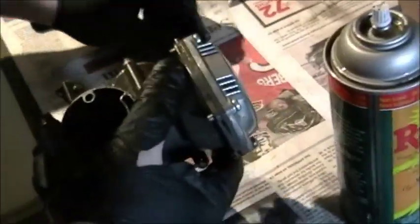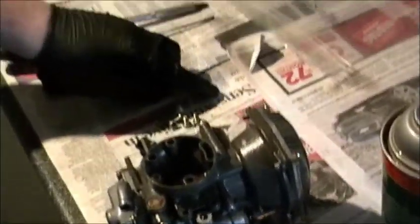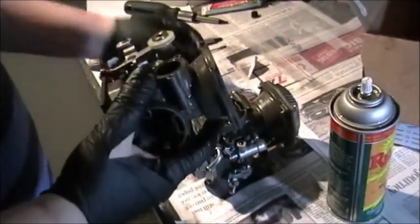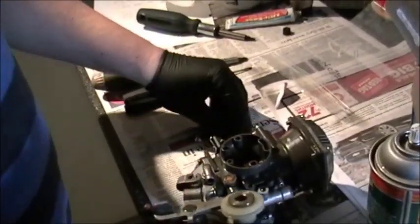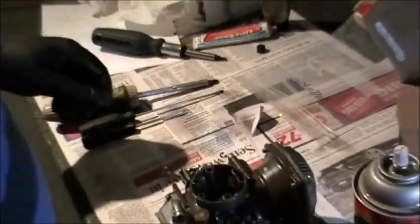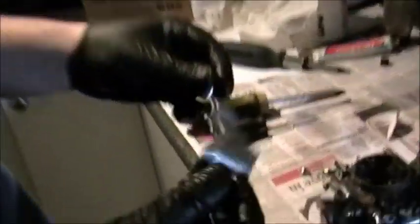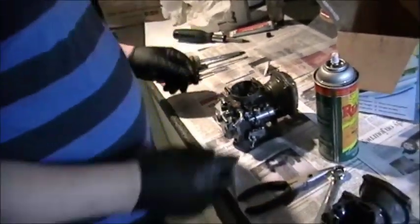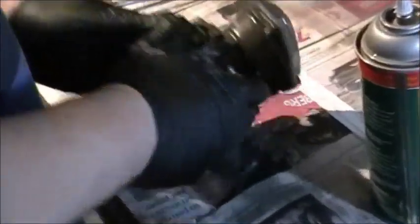What screws have we got left? We've got screws for a bracket, this little E-clip — one of the specialty items we talked about earlier — and this screw that holds the throttle cable bracket on. Four mid-length maybe 10mm screws hold the bracket on when we're all finished, but we're not quite there yet. Instead we've got one complete carburetor. Second verse, same as the first — and we'll pause and see you in the next few minutes.